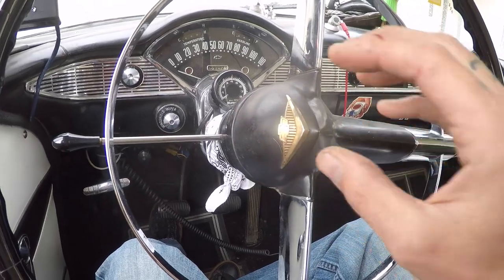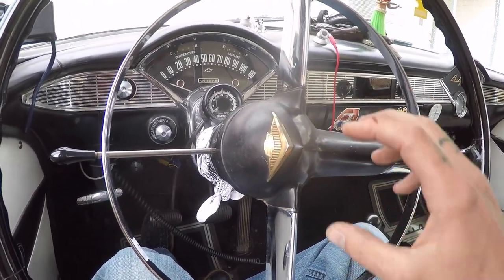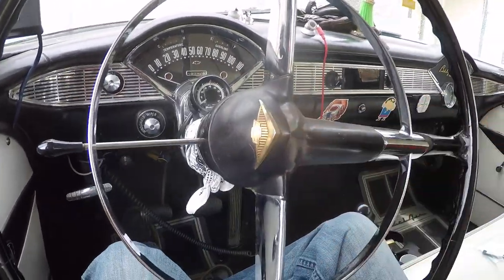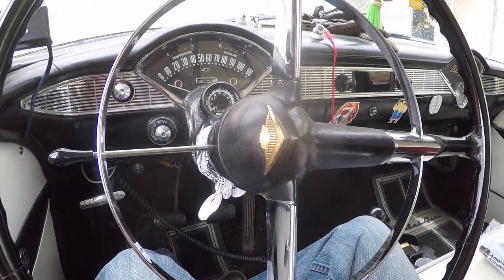It's pretty basic. Just got to get the wheel off. Luckily I have a steering wheel puller, otherwise I could rent one from AutoZone or any other parts store. Pull the steering wheel, get the switch out, replace the switch with the new switch. Once that's all done everything should work and I can wire the taillight back up properly and have blinkers.